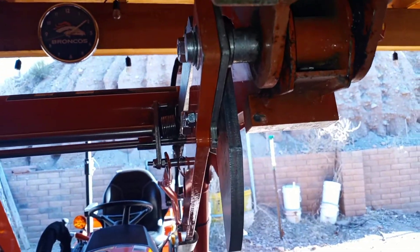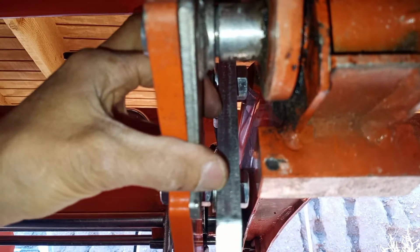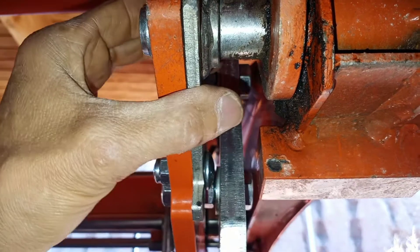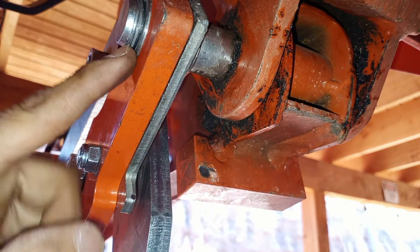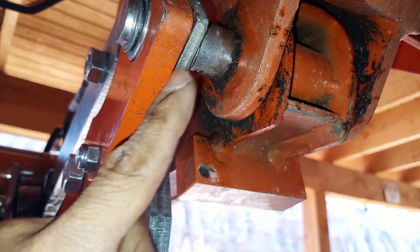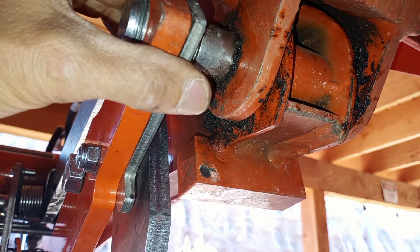The way I am fixing this: there's a snap ring right here that needs to come off. When you take this snap ring off, this whole system can come out, and now you can put a bushing in there. In my case, I am placing a bushing in there to eliminate some of this free play. You need to leave enough room on this side so that the snap ring falls back in the groove all the way around — that's very important; you will have catastrophic failure if this does not fit in there properly.